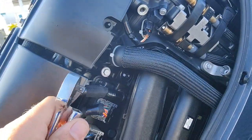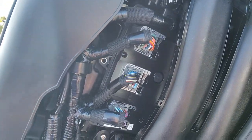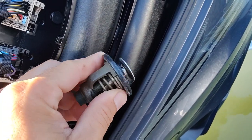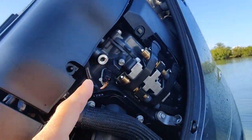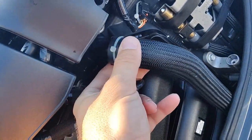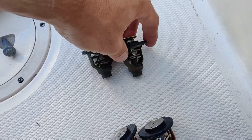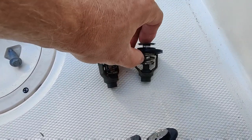We're over enough here. I'll pull this off — I need both my hands — and we'll see what's happening underneath. Well, look at that, stuck open. That causes the water to flow too fast through here and then you get overheating basically on the top of the engine because it's all aeration. So we're gonna change both sides, we'll do the other side also. Just two 10-millimeter bolts takes this off. Here's our far starboard side — here's our problem the whole time. You could actually run the motor up past idle and it'll be fine because you get enough water flow at that point, but that will definitely cause an idling overheat.